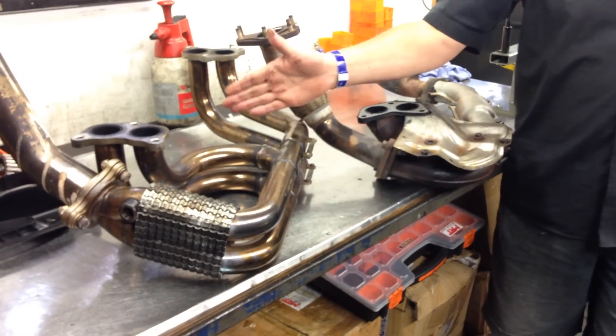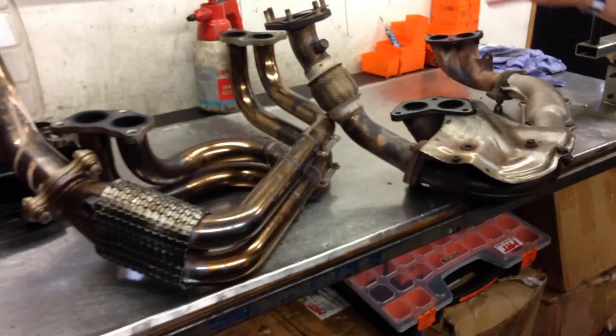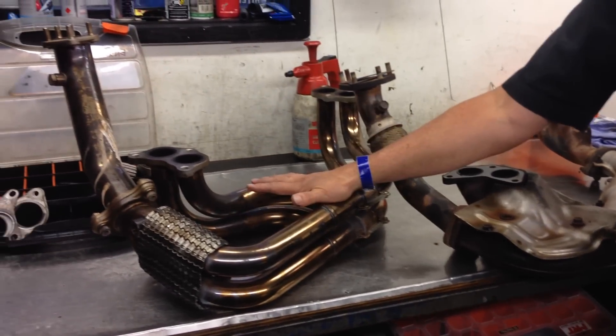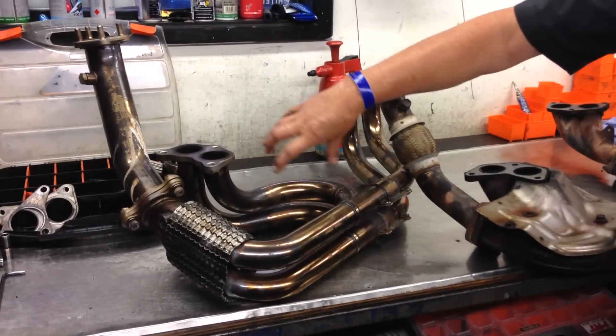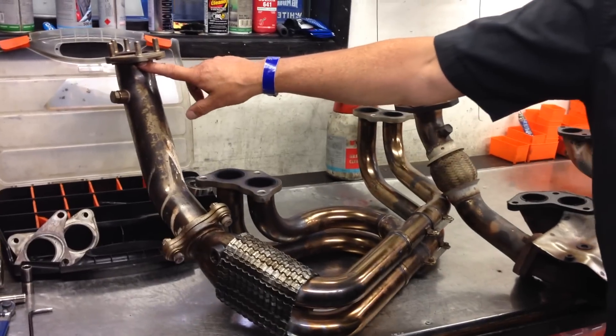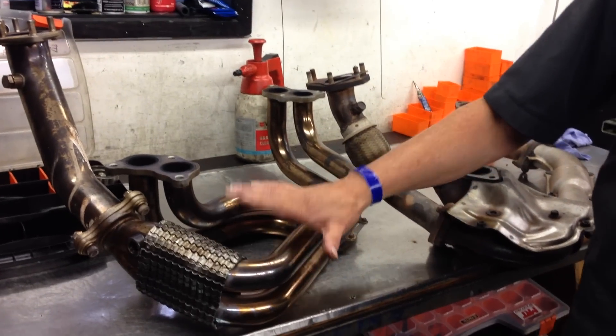The comment that is important to remember at the end of this video is: matching the parts. Bigger is not always better. Different brand exhaust manifolds have got different diameters — some of them are equal length, some are unequal length. That typically changes the note of the exhaust, but equal length design creates a consistent exhaust pulse, single one out up to the turbo, and is generally accepted to bring the car on boost a little bit earlier.